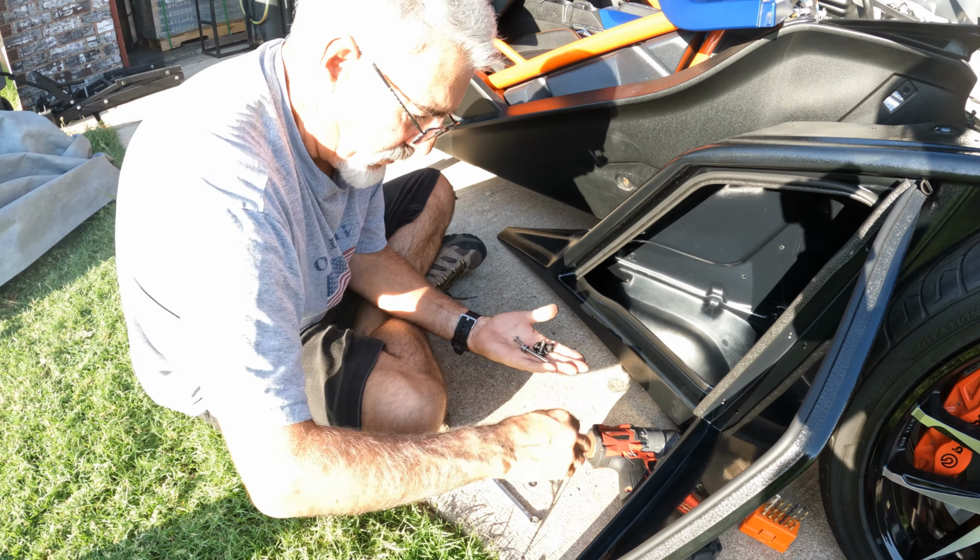I used a lock washer and a flat washer, and it's getting tighter. And it's really tight. It feels like you want to break the head off. But what you do is you look for it. See, still spin the washer. You don't have to make these so tight that you break it. No spin. No spin, pretty tight. I'll go a little bit more. I still see the lock washer still a little open. There it is. That's as tight as you want it.